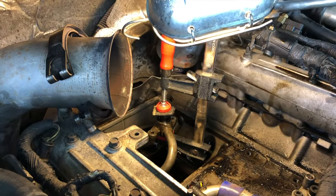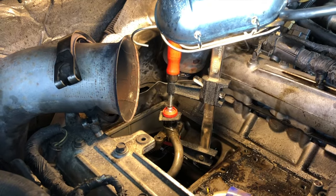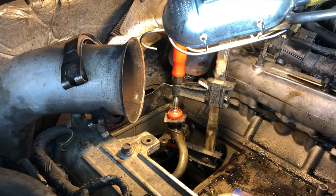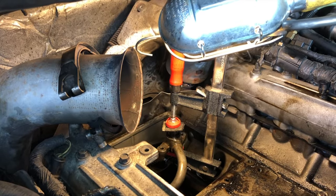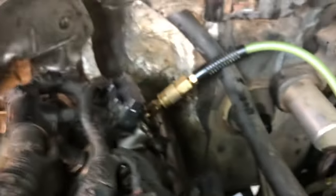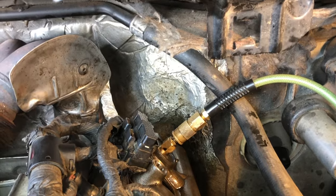I'm trying to figure out if I have a bad HPOP on my truck. I had air hooked to the ICP and then the dummy plug on the driver's side. I could hear air leaking but it was hard to tell where the sound was coming from. I really want to be sure I've got a bad HPOP before I buy one — six hundred dollars, you know. So I took two pieces of rubber from an old tire, sandwiched one on the bottom and one on the top with a clamp, hooked 150 PSI of air into the dummy plug port on the driver's side, and there was no air leak. Since air was leaking when the pump was in, I have to assume I have a bad pump.